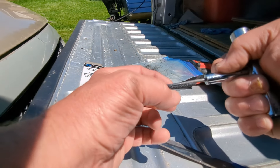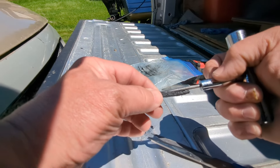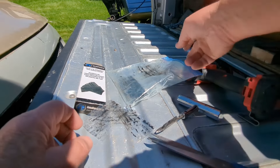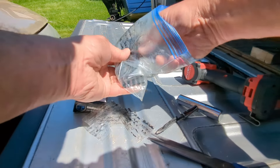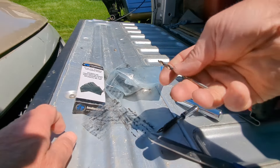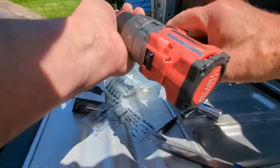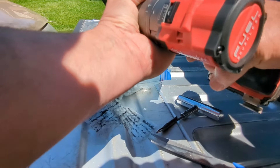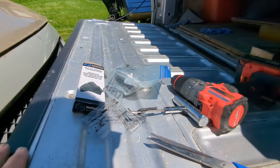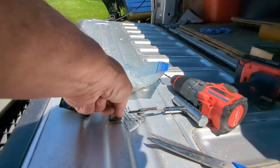We're going to stick this through the eye of the installation tool. Just squeeze the end of it a little bit flat to make it easier to get started in there — it's like threading a sewing needle. Stick it on there and pull it about halfway through, about like so. When you shove it in the tire it'll fold back, so pull a little bit more through. When you retrieve the tool really fast, this end here is split open and the tool will just slide off.